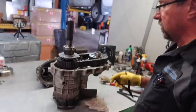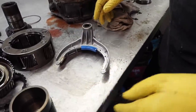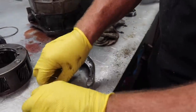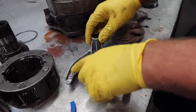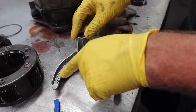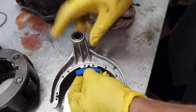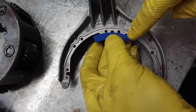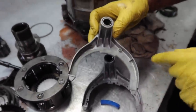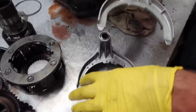We got our mode fork out — kind of what I suspected. These pads come from a 208, 241, or 243 case from the '80s and '90s. When the plastic burns off, some manufacturers grind it back off, drill out the holes, and use replacement pads — but the pads aren't fully supported on the end of the fork by a good three-eighths of an inch. We would never use this. Here's our brand new fork: the whole thing is injection-molded plastic on both sides — this is an OE design. Whoever rebuilt this original case clearly cut corners.